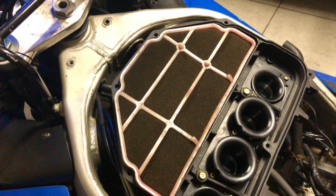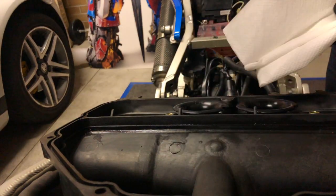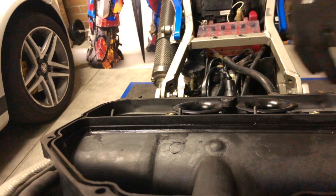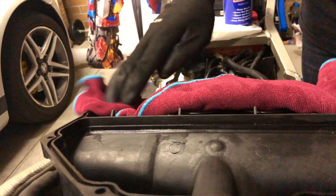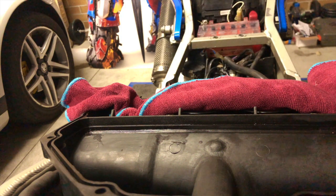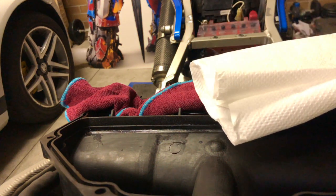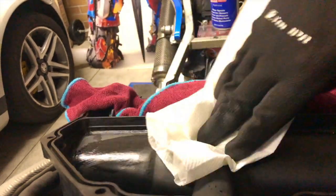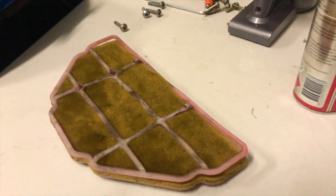What I'm going to do is put some WD-40 on and clean the actual air box itself — just wipe off all the grease that's collected in there. Obviously you've got to be careful about these intakes over here — don't let any screws or bolts go in there while working on the bike, because once something goes in there you'll have to undo the whole engine. Just put some on a paper towel and wipe it off.